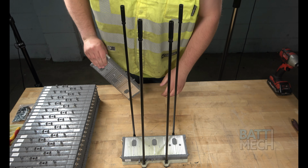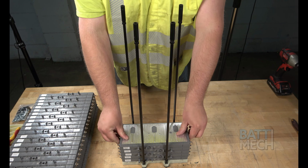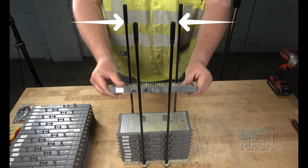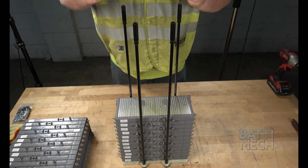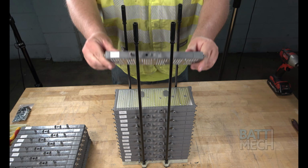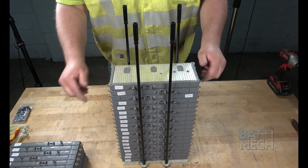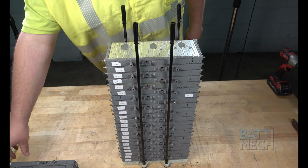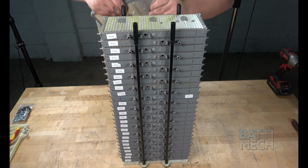Now, go ahead and stack the modules into the battery compression block. Note that the black buttons will remain at the bottom of your stack. The two wider posts should be in the front, facing toward you when you load the compression block. As you load the modules, the numbers should be upright and facing you. Number 1 will be inserted into the compression block first. Then, continue to stack modules sequentially up to number 28. When completed, the stack of modules should look like this.